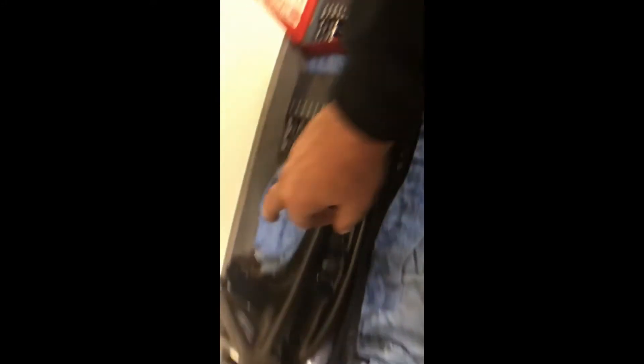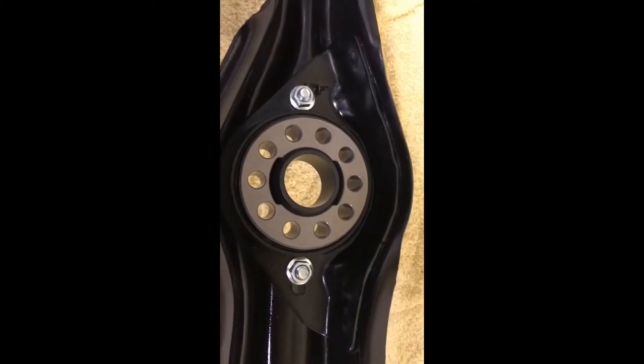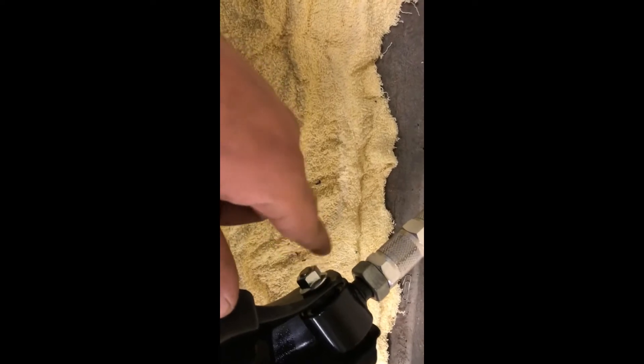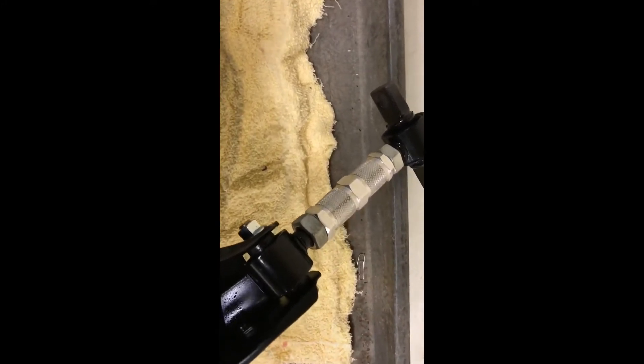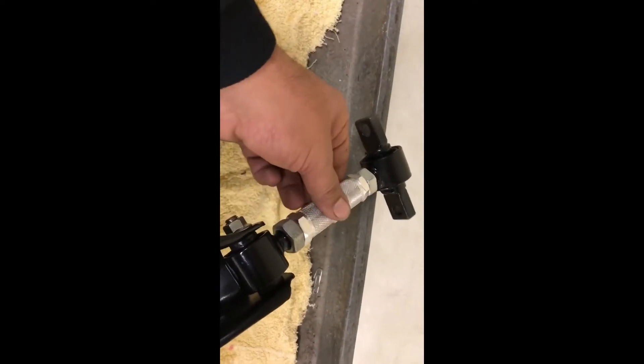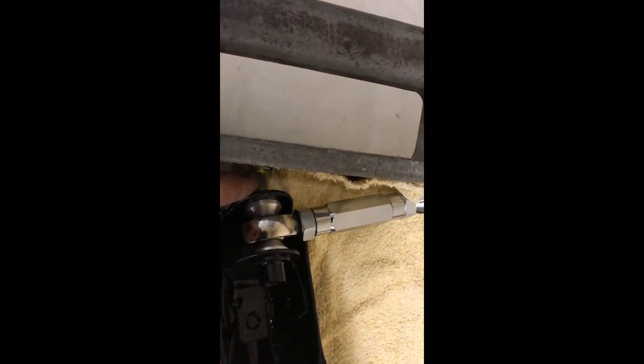Once you reach this point with the two nuts tightened up on the back, we're going to move to the camber arm. There's usually a welded bolt here, but my bolt snapped off so I ground it off. The bolt size you need is an M10 by 1.25 by 60mm. Put the bolt through and tighten it up, but leave it loose until you get it on the car so you can adjust it as needed. For the toe arm, I have a spherical one I purchased off eBay. The little brackets on the side were a little bit too long so I had to shave off a little bit. Again, the bolt size is an M10 by 1.25 by 60mm.